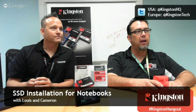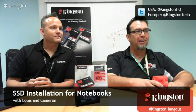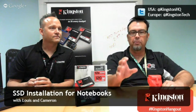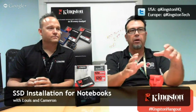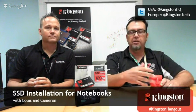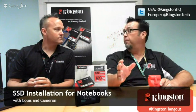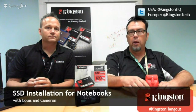What's the difference between an enterprise-level SSD versus consumer besides price? Well, Lynn, price is definitely the first one. I would say the biggest thing is really two things. There are some enterprise features that we will add on to our enterprise SSDs. The biggest one is power fail. When we first launched SSDs in the market, we started with more of a consumer line, mainstream. As we got serious about the enterprise market, one thing our customers wanted was some type of power fail protection. So on our E50 and E100 enterprise SSDs, we have power fail.